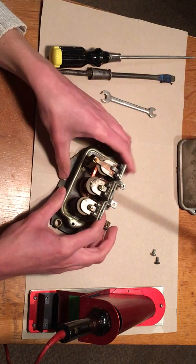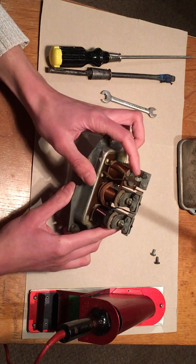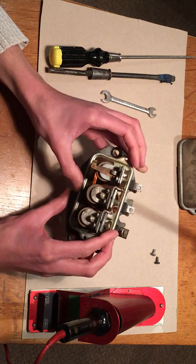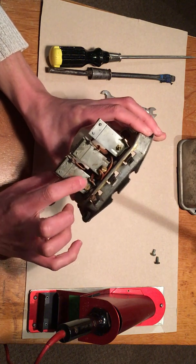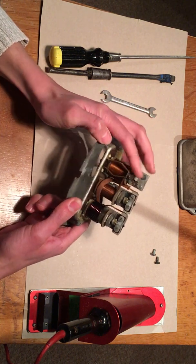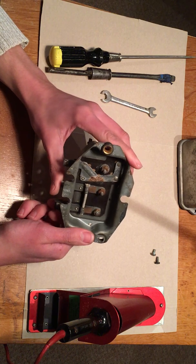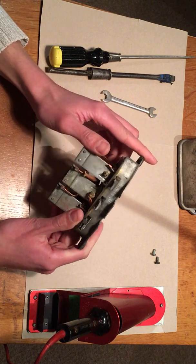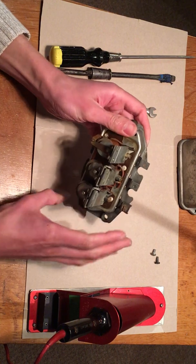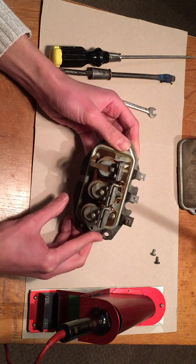Which is pretty easy to do on these. You've got three bobbins here - this is the cutout here, and these perform the separate functions of current and voltage regulation. These were the adjusting screws to regulate the charge. That was the cutout there with its contacts. So it's pretty straightforward a unit, which also means it's quite simple to dismantle. That's the main job for today - to strip everything out of here while retaining these contacts for the existing wiring. I'll retain these terminals and then I shall be able to fit the modern solid-state regulator.